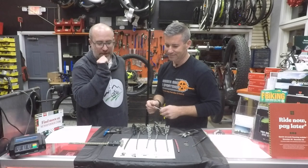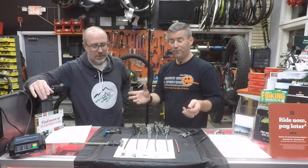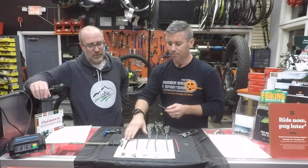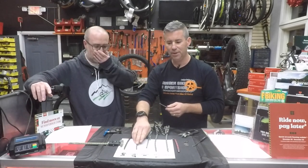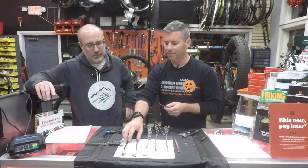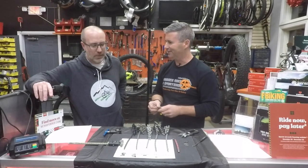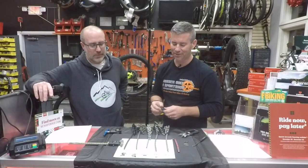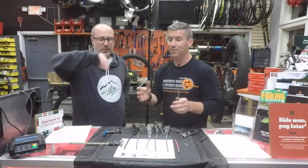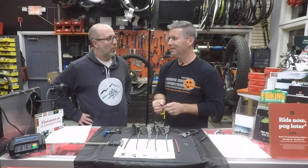What is compatible with what? If you're riding with friends and someone blows up a chain, try not to skip more than one speed. If you have 11-speed and they have 12, you can make it happen in a limp-home situation. If you have nine and they have 12, you might end up buying them a cassette or a derailleur. Try not to go further than one speed apart. And this isn't going to be perfect — it's just to get home. It might still shift a little weird.